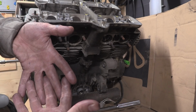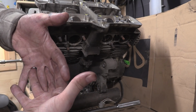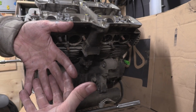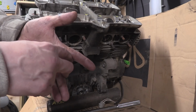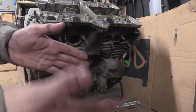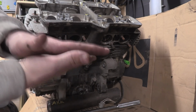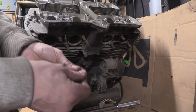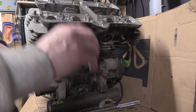Now what happens is, when you heat the nut and bolt fitted, they expand into these regions. They crush the rust. When they shrink back to normal, the rust that was almost acting like a spring, applying a preload, has now been crushed. But it's not like a spring, it's like a cracker. You get a cracker, you flatten it, you take your fingers away the same distance apart, and the crack has been caved in. It's plastically deformed. And that's why it comes out.